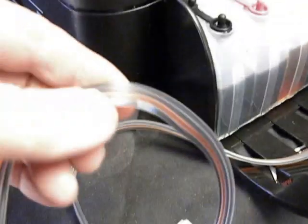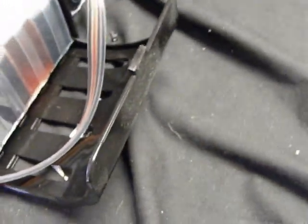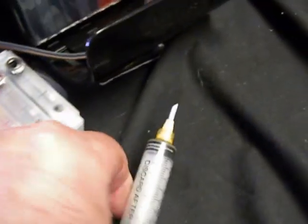This has been sitting for quite some time in our warehouse without cartridges. Now we're going to show you how to prime up the CIS system. That's been sitting a long time, so you get some air in the lines. A little bit of air is no problem, but when you get a lot of air you've got to prime it up. In our continuous ink system, Executive 2, we give you one of these syringes and then the purge syringe. I'm going to show you how that works.